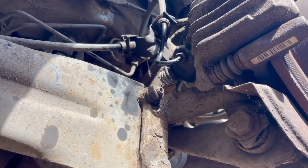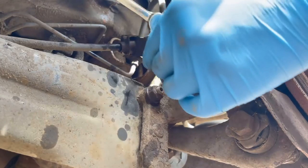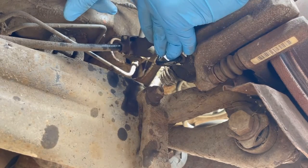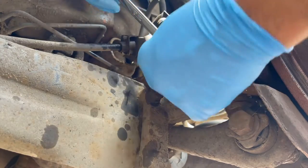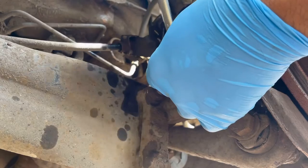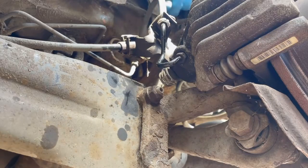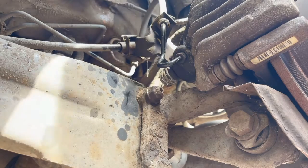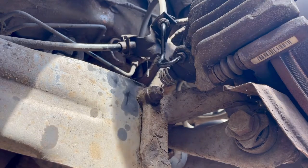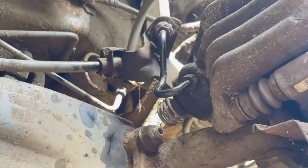Do the job. So I'll start off with taking off this brake hose. It's a size 11 wrench. Okay, so that wasn't too tight. Try and loosen that one off as well. That one seems a bit tighter, but I think I've got it. I'm gonna have to reuse this, so need to make sure we don't damage it. And before I completely loosen it off, I could have put a clamp on here, but there's no way. I'm gonna have to try to put a stop in there to stop the brake fluid leaking out. But before we do that, let's try and get this loose. Take this off. Okay, got that off.